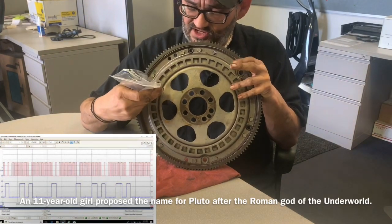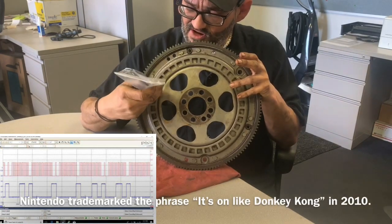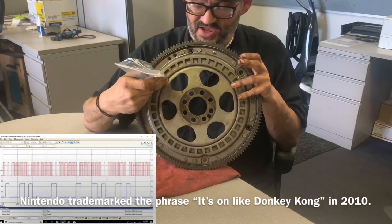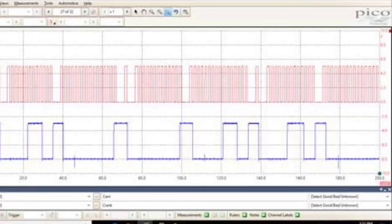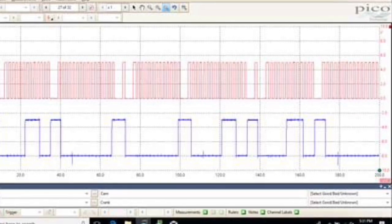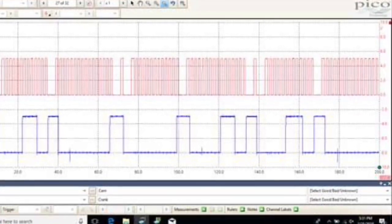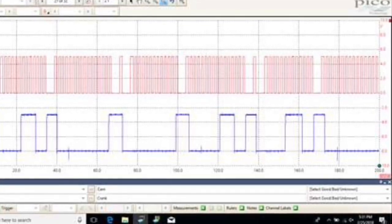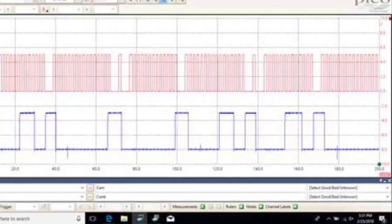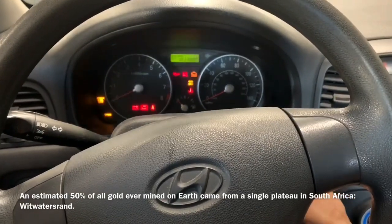Most engines will not run without a crank sensor. They need the crank sensor signal to tell the ECM where the engine is located, coordinated with the cam sensor. You can unplug the cam sensor and see if your engine performs better. That will also tell you that your engine is out of time and that it needs to be repaired. Trying to give her the old test-a-rooney and make sure she works.